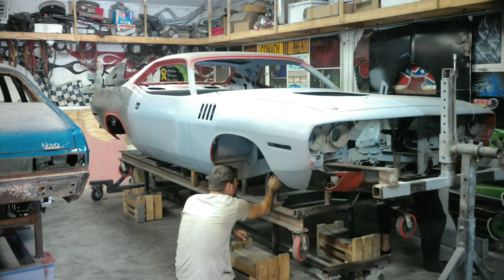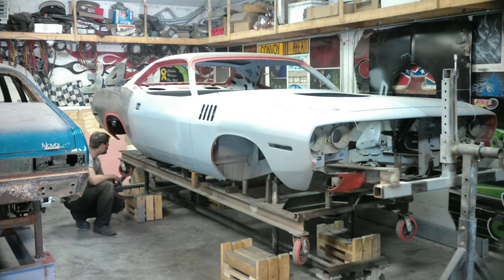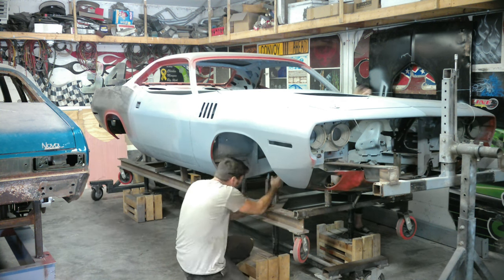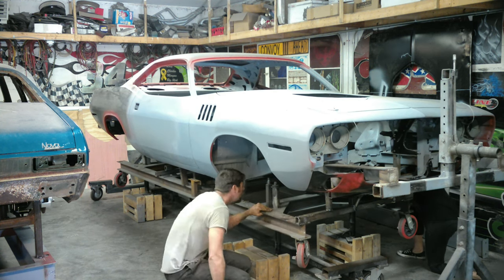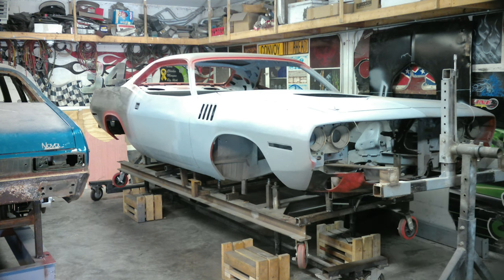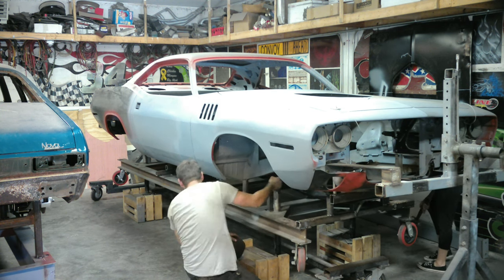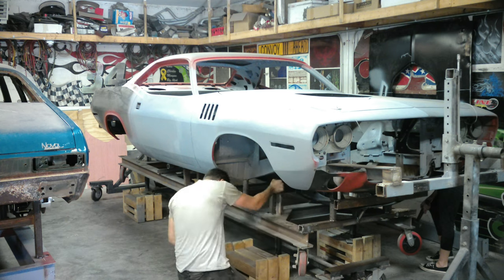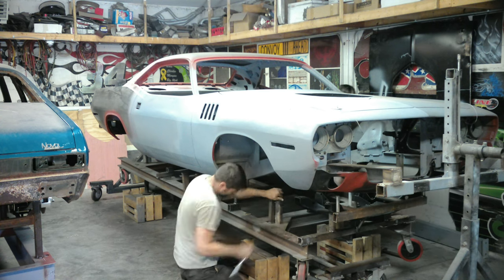Our rotisserie is set in place — this is exactly where we need to be. I know we're really close because this is where the car was on the rotisserie when we first decided to strip it down, with the hood and fenders on. Now we're doing the opposite — taking the frame jig and screwing down on the trailer jacks to lower it. We're pinning up the frame jig to use as a reference for future E-body cars, including the crashed one you'll see in the next video.